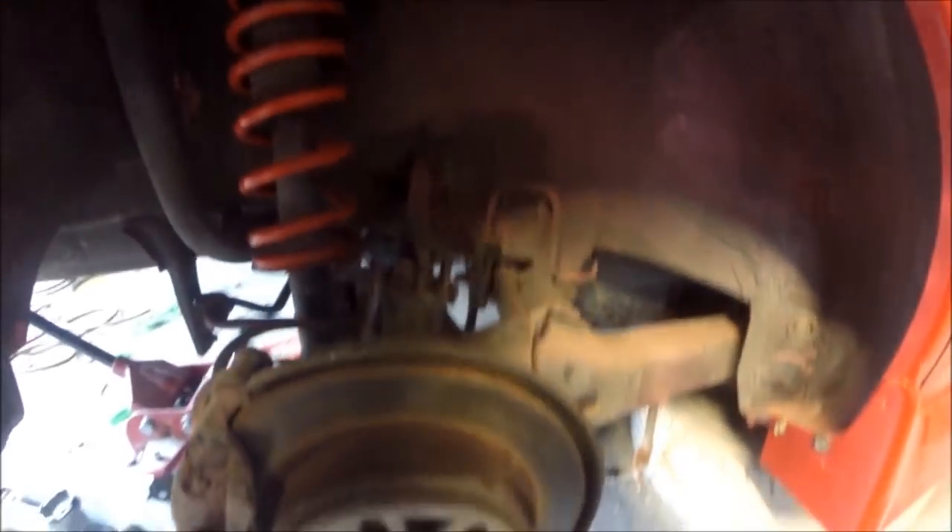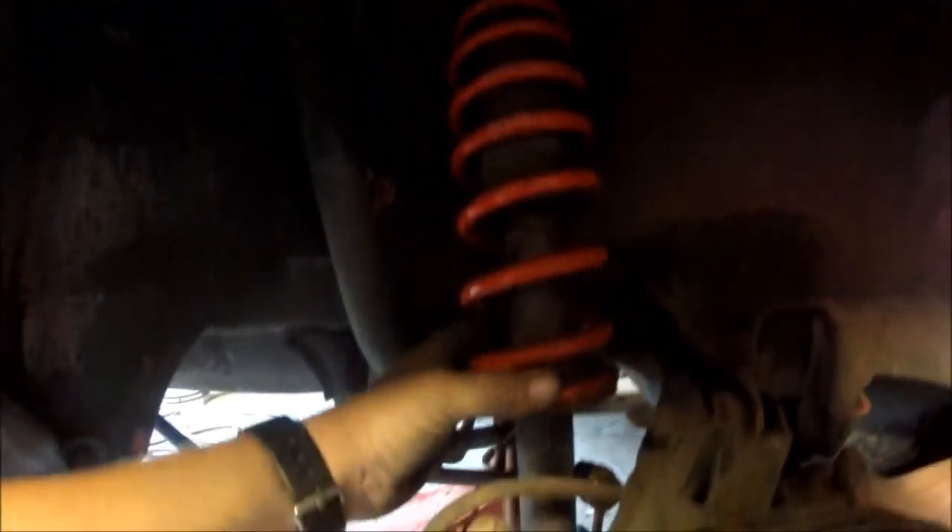Back together. Now I bolt it back together and set it up in place. Once there's tension on the hub and the strut's bolted back in, it's only uncaptive by about 10mm — 10mm more spring would do it. It's back in there. It didn't sit captive when I put the spring in — the shock actually rose higher than the spring. But now it's in there with all the bushes and suspension, it's actually in there pretty solid. These are out of a different shape, so the strut in the Evo 4-shaped Lancer is probably longer. The diameter on this one's all good. Put the wheel on and jack it down, see what it looks like.